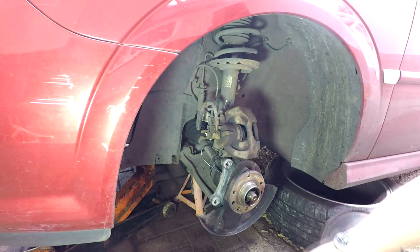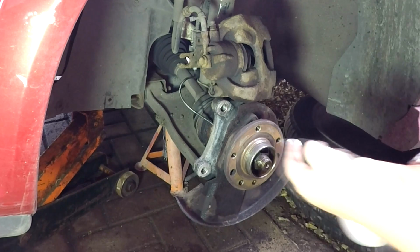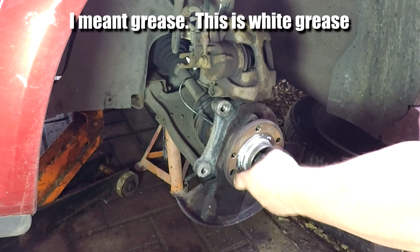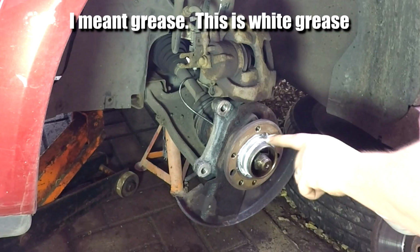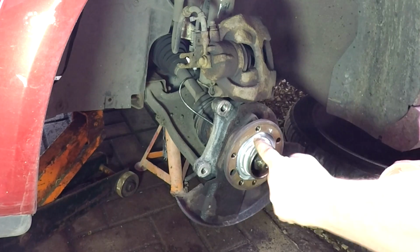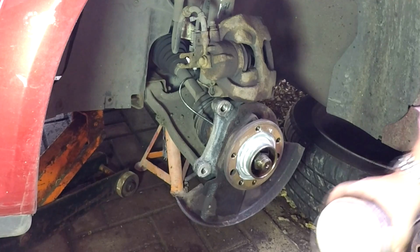dust plate as well. And just to make things a little bit easier when you put things on or maintain and service them again, I'm just going to run a thin smear, only a thin smear of oil around that inside lip there, because quite often what you'll find is that when you take a disc off, it's seized onto there with rust. So just putting a little thin smear of grease on there ensures that if these have got to come off again, it'll be nice and easy.